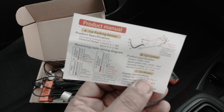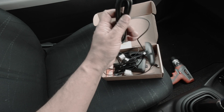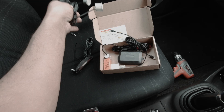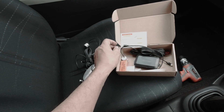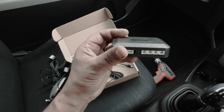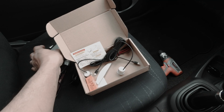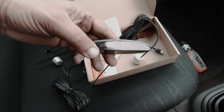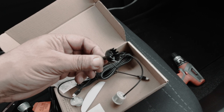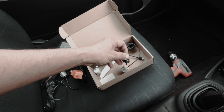The instructions that come with these kits aren't brilliant, but they are pretty easy to fit. You get everything in the box: a little display, four sensors that we're going to drill holes in the rear bumper for, and a connection box which is all self-explanatory. You also get sticky pads to mount the display somewhere on the dashboard for visual cues when you're too close to something.